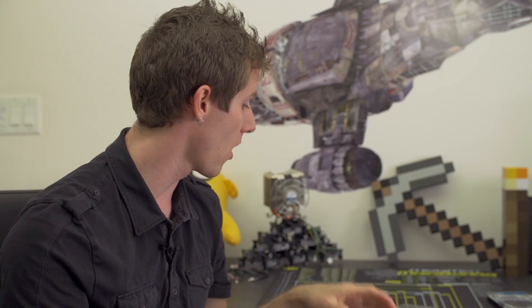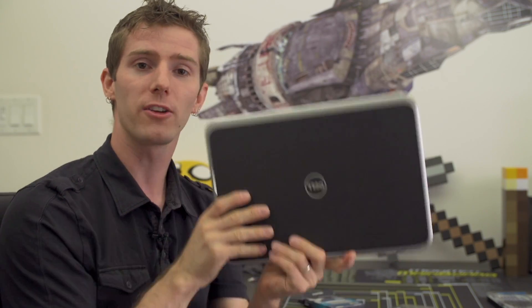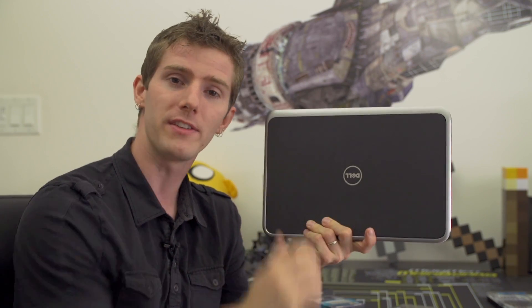It's really important to find out from the manufacturer what type of drive your model accepts — whether it's a 9mm 2.5 inch drive, a 7mm 2.5 inch drive, a 5mm 2.5 inch drive, an mSATA, or even a proprietary standard. For example, Apple's recent notebooks often use soldered SSDs right on the motherboard, so you can't replace them at all. Work from that knowledge. So without further ado, here's my mSATA SSD upgrade on the Dell XPS 12.